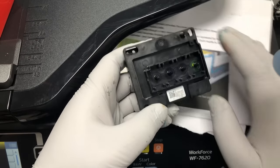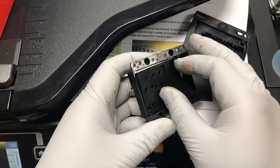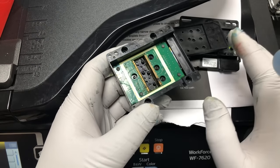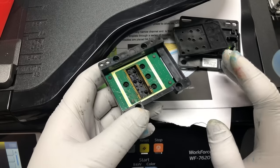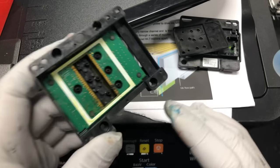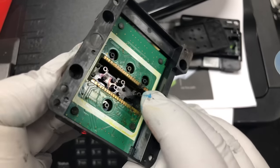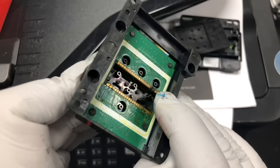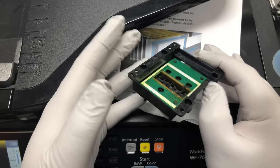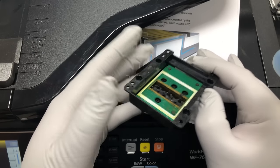Pushing too hard might cause a leak in the rubber layer and therefore get an IC board wet. Once the IC board is wet, it's almost impossible to dry out unless we open it up. If the printhead is not dried properly, it might cause a short circuit right here and permanently damage the printhead. If you fry the printhead, your mother-in-law will not be happy because you burned her printer. When she's not happy, you'll get disinvited